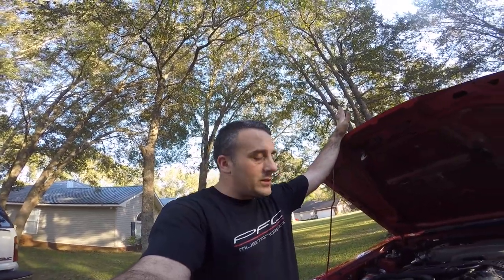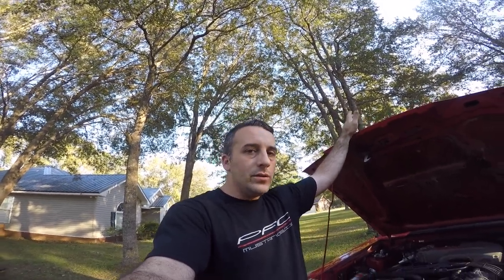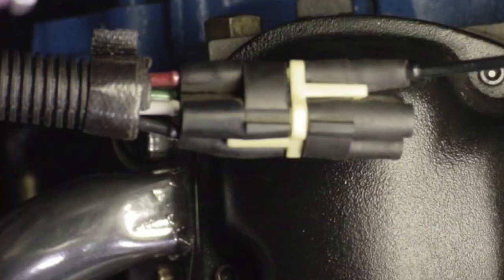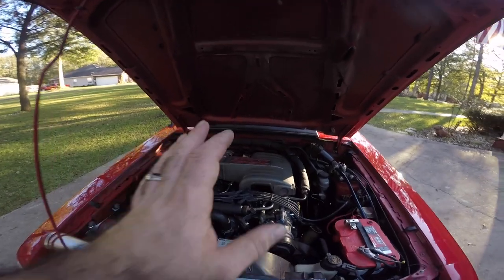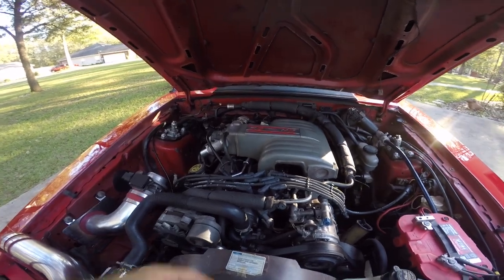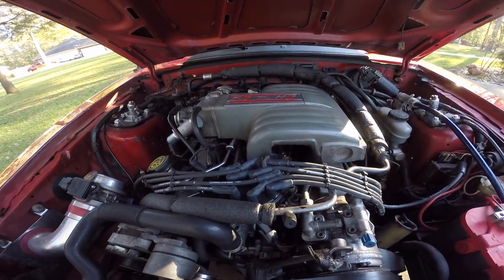More than likely it's going to be a vacuum leak. I know that may sound crazy to some of you, but some of you also know that what I'm saying is the truth, and it'll make you want to give up on one of these cars. I'm telling you, you will chase and chase these problems down. You need to learn your car. Like I always say, get out here, do your research, look around, dig around, try some different things. If you're ever out here messing with your car and you start taking things off and moving things around, like vacuum lines and stuff, always take a picture before you start. That way, if something were to happen, you can always come back and put everything back like it was at least. Improper vacuum routing is a major, major issue with these cars.